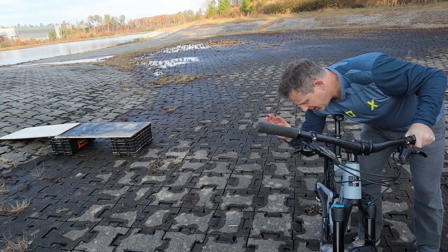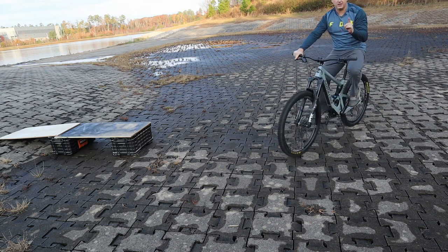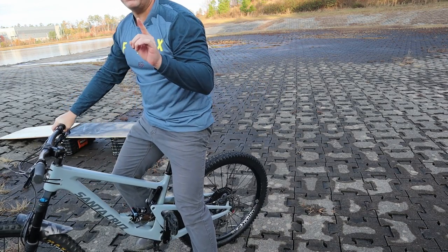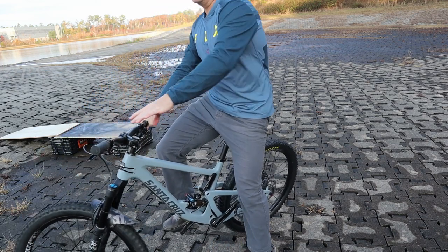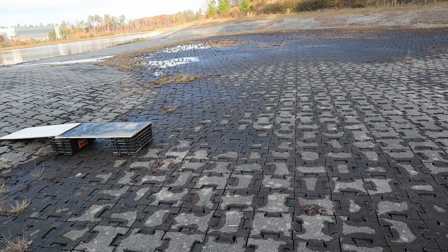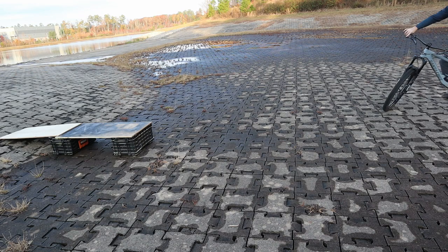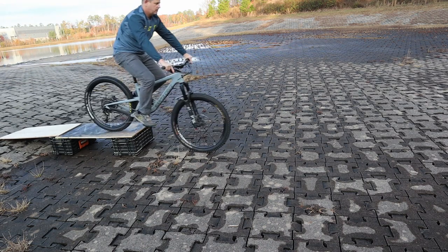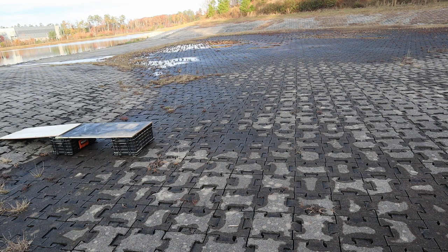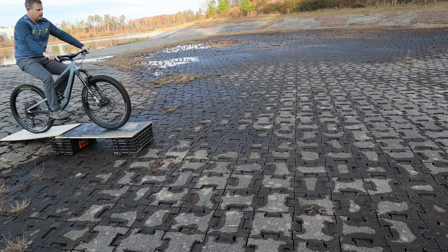At 4 clicks that felt much better, but there was still a little oscillation. Keep in mind we're running more air pressure than recommended to hit our sag point, so we'll likely need more rebound damping too — these settings do correlate. I'll slow it down to 6 clicks and try again. That felt pretty good but I think one more click of rebound would flatten it out. At 7 clicks — pretty good. Let's try 8 clicks.